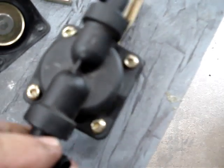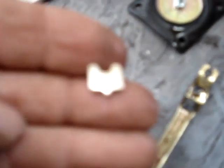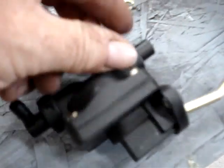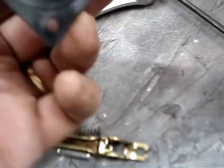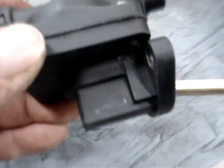I didn't go into too much detail on taking these little pumps apart, but there are just four screws on the top. Take those out and it splits apart. Your diaphragm will be hooked underneath — you can just twist it and take it loose, and it comes right out the top. The pin just comes out. The little holder tabs are pressed inside the pump and they just slide out. Pull everything out from the plunger to get it out of the way. I just took an air hose and blew the top valve loose — just put some air on one of the inlets and it will pop right out, though you may have to pry it a little. Once you get it all gutted out, put your gasket back in, four screws, and put it back together.